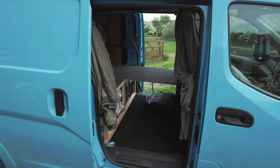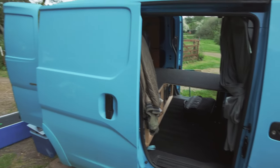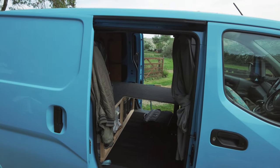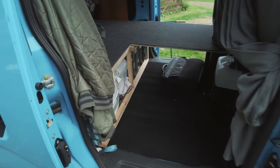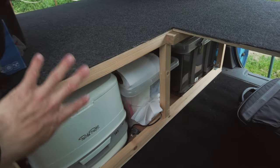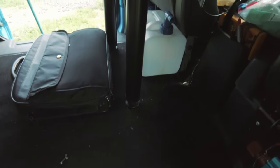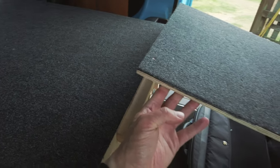Since I have the van cleared out, I thought I'd give you a little tour, because this is a self-build camper. It's not obvious that I'm actually sleeping in it, which is great for travelling and pulling up in car parks. It's very simply made — I created this square frame which just sits straight into the back between the wheel arches. It's just a box frame using some timber, two by two. Then I made this part that comes out and sits here — this is where my feet go at the end of the bed. It easily drops out so I can put it away if I want all of this space for sitting in.